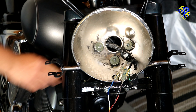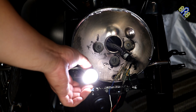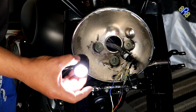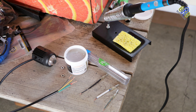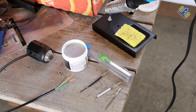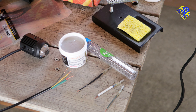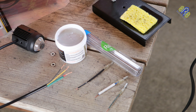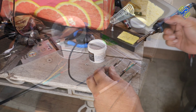First of all, thanks to brother Polly for this driving light that I'm DIY-ing to use as my turn signal light for my Yamaha V-Star 1100 Classic. First, I cut the cable of the driving light to the length I need. Then I cut the wire pin connector of my stock turn signal light at least three inches each, and I splice all the wire ends and add shrinkable tubes.